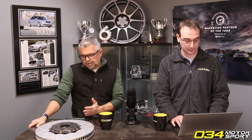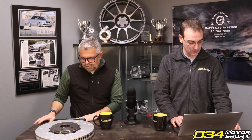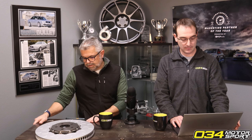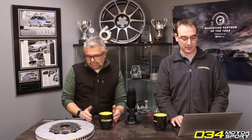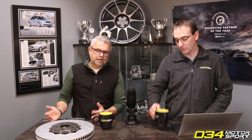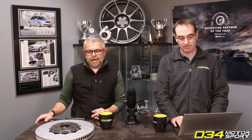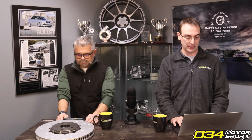It would be good to know what tire setup you went with — you don't say that. Tire pressures and all that matter too. You changed your wheels and tires and substantially increased your power at the same time. Chances are your new tires are probably as grippy as your old ones, but it's just the power that's spinning things. It also depends if you went with a 21-inch or some really low profile tire, because that can certainly impact traction. If you're running a 21 or 22 on a 25-series sidewall, then yeah, you're just going to have less grip.